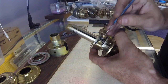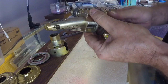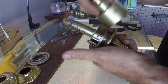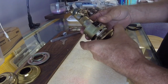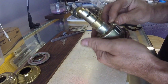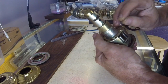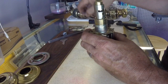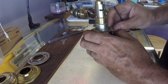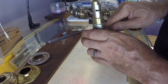Make sure your springs are engaged correctly and that it turns from both sides. You might want to go ahead and put this on first before you do that — slide it on off-center, turn it, and then drop it the rest of the way. With this one I only had one cotter pin, but if you had two, when you put this one on you don't want the long side of the leg to be on this side, because when you put it together the leg will poke out and interfere with the latch. That is something you need to watch out for.